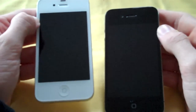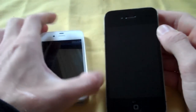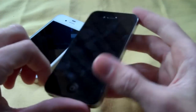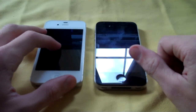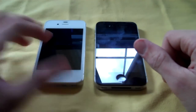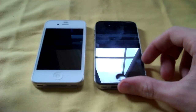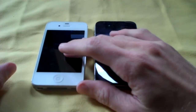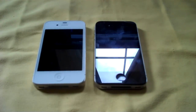The A5 processor is in the iPhone 4S as well as the iPad 2 — it's a dual-core 1 gigahertz chip, though on the 4S it's underclocked to 800 megahertz per core. The iPhone 4 has an A4 processor at 1 gigahertz — the same as the iPad 1 — and it's only one core. So theoretically this should be about twice as fast. Apple says the graphics are twice as fast. Keep in mind that most apps in the App Store were designed for the older hardware, so developers haven't fully optimized for the 4S yet — that'll improve over the next few weeks and months.